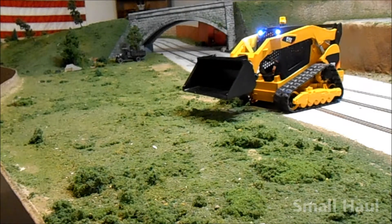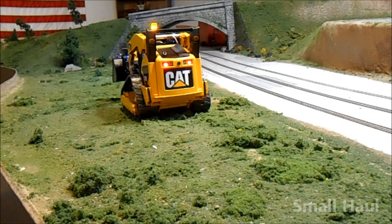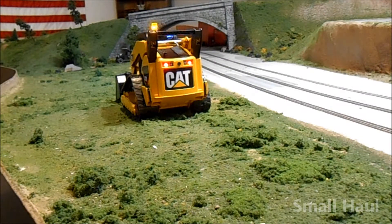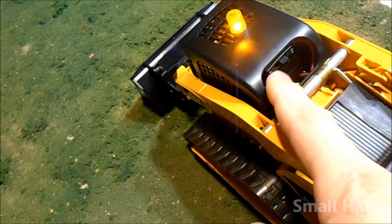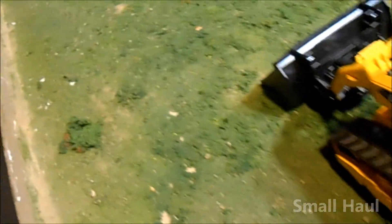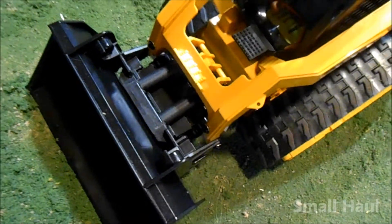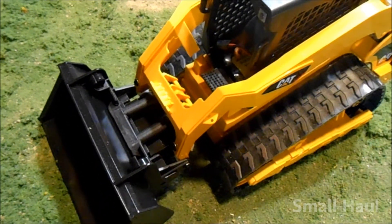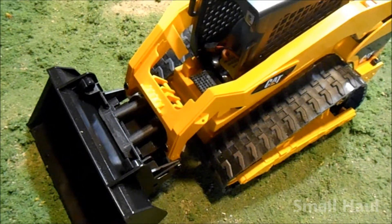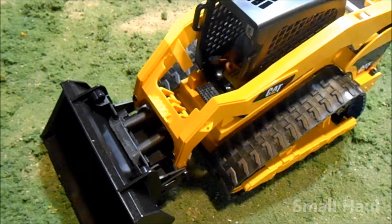Oh yeah, let me go over the actual vehicle itself. Let me fire it up. There's your on and off switch right here — that's how you turn it off, and your charging jack is right here to charge it. It's a six cell 2,500 milliamp NiMH pack and you'll charge it at about one and a half amps. It probably lasts an hour and a half. I used to run a 1,600 milliamp pack for years that would run for about 45 minutes, so you'll probably get a good hour and 15 minutes to an hour and a half out of one charge.